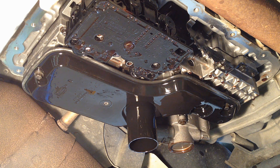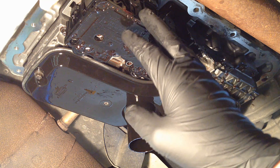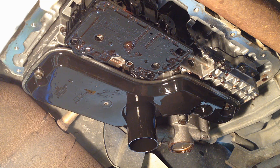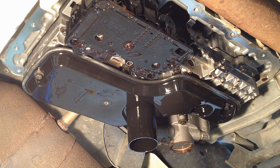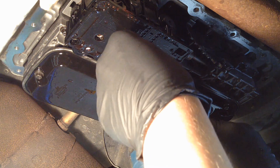Today I've got a 2008 Ford Explorer with the 5R55S transmission and we've got a harsh and delayed reverse on it. These are common for a solenoid pack, but also for the valve body — the actual valves inside can stick and cause harsh engagements in reverse only. To swap the valve body out, we're going to pull the pan down, drain the fluid, and pull our solenoid pack. I have a whole video on that so you can get to that point.